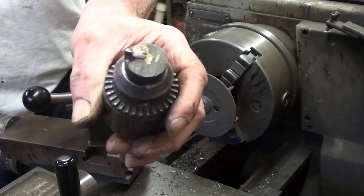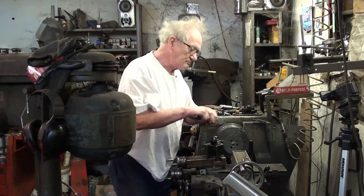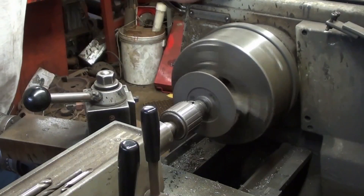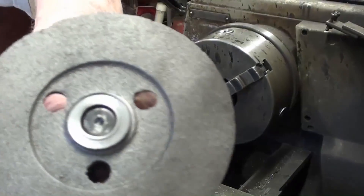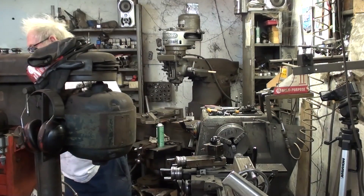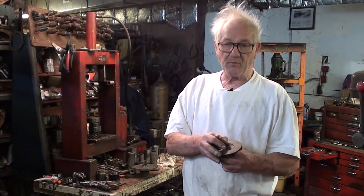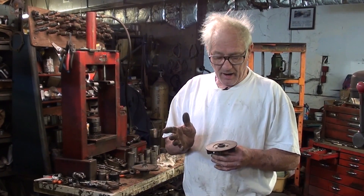You'll have to use your own tooling. Over the years I made a tool so I don't have to measure — I just machine it and I'm done. Here we machined the groove, as you can see, for the mating ring. It's not the smoothest one in the world, but that's okay — we're going to use JB Weld anyway. Here's the mating ring that eventually we're going to JB Weld in there. We're going to machine this to a perfect 90 on the axis and polish it.